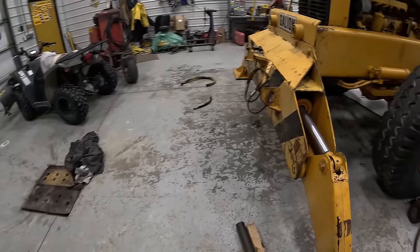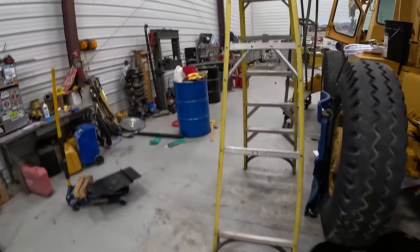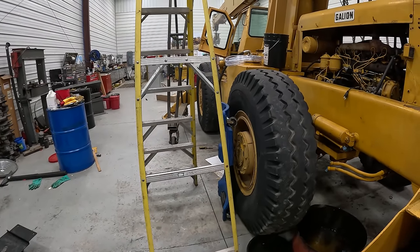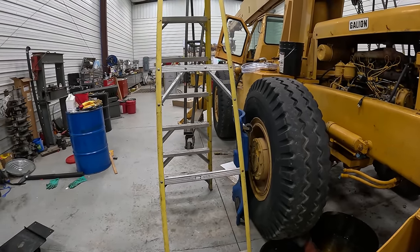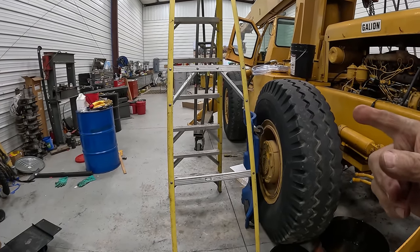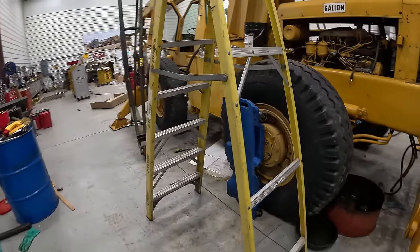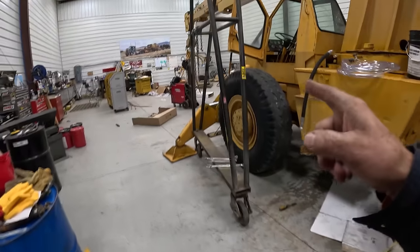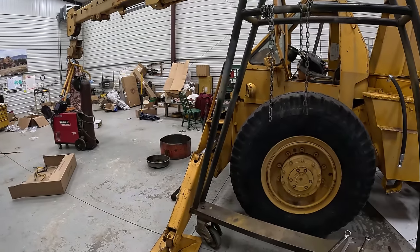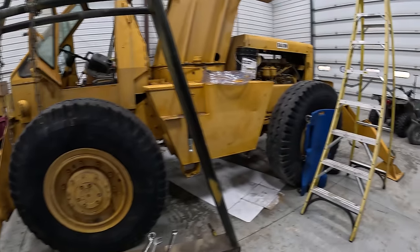So, I ordered a square O-ring kit so I can start cutting those O-rings out of that plate gasket. And that's going to be here Thursday, I think. And then my O-rings from Cherry Picker Parts for the swivel valve aren't going to be here till Friday. So I'm thinking about loading up the steering cylinder and the outrigger ram and heading over to Napa and get them over to Andy so he can start working on those.